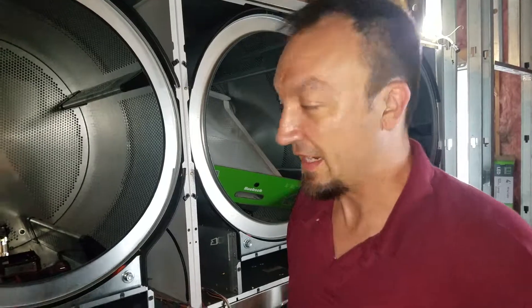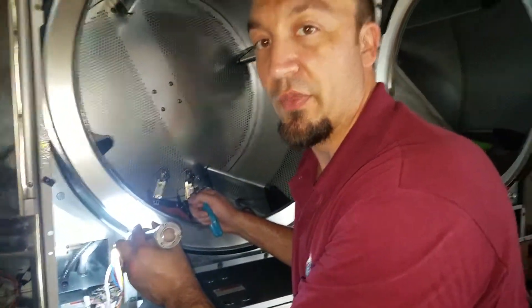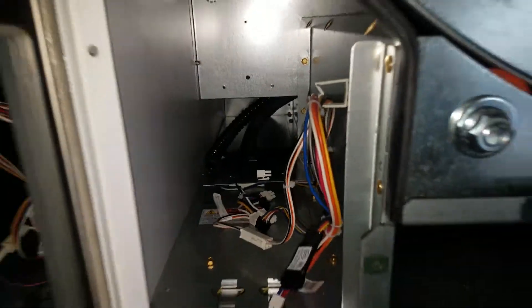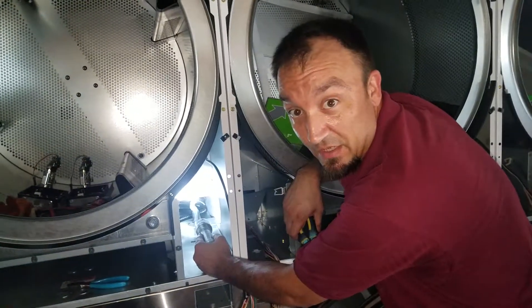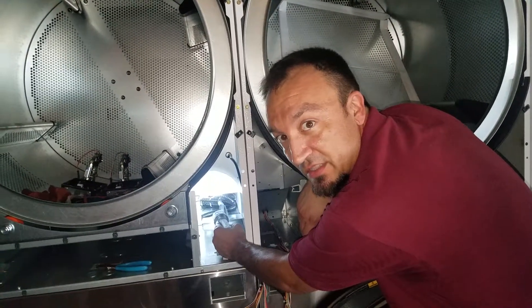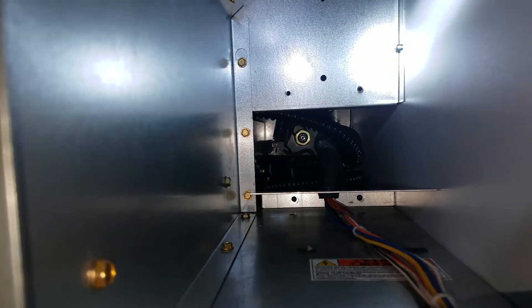Now that we've got the zip ties cut, we're going to look down here. This has a connector head which will not fit through the port that's in between the dryers, so we have to cut this cable from this end and then we'll be able to pull it all the way through the dryer and out through the back. Also, you have your lint door switch right here, and both those perforated tubings are right underneath it, so you just have to be a little careful with that.